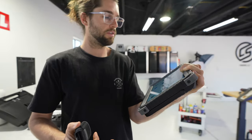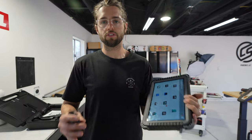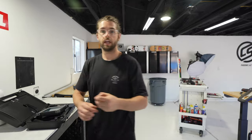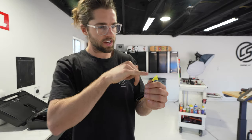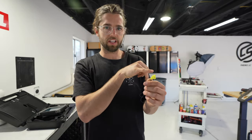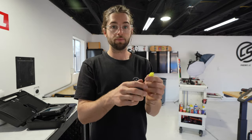It was able to tell me the passenger seatbelt had something open — it was the second plug. That little clip was there but didn't fit as tight the second time I put it back in, and that was causing the airbag light. I ordered the part, got a new clip, clipped it in, and it worked. I didn't mess with anything else or chase any other airbag issues. It saved me so much time. The second thing that happened was when I put the risers on — I thought I clipped everything together, but I had an airbag light. Plugged in the scan tool and it told me: passenger occupancy sensor circuit open. I looked, scuffled the wires underneath the seat, realized I forgot to plug it in. Light went away. Saved a bunch of time.